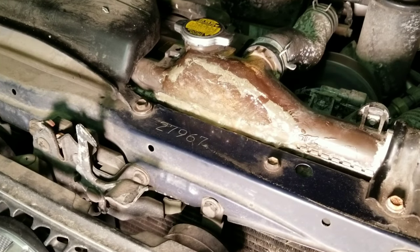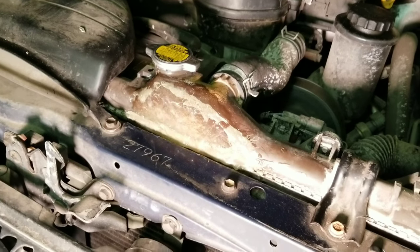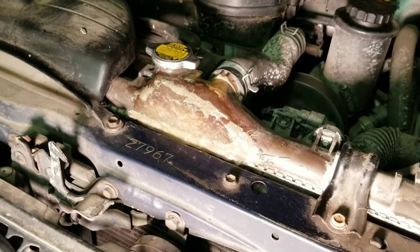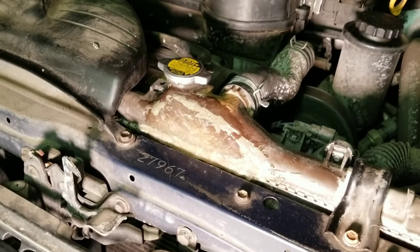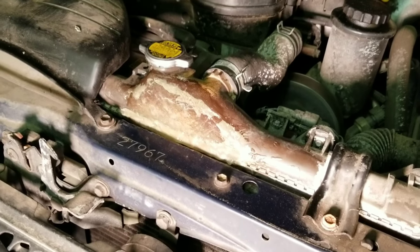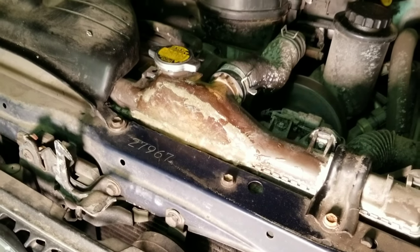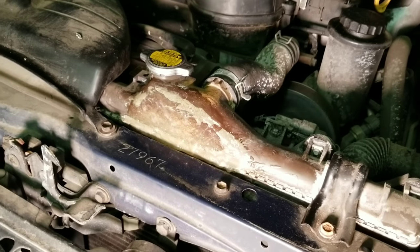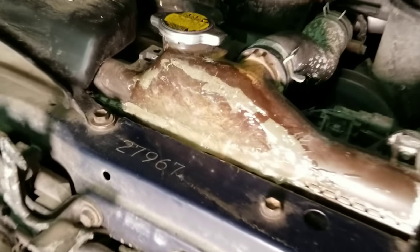So here's the deal: one whole thing of JB Weld — it comes in a cylinder syringe type, you mix it together, use the stick provided, and I'll put what I used in the description. It took me maybe 15 minutes. I cleaned the surface, put it on, and I did three coats. You can't do it all at once because it goops to the bottom. Takes about five minutes to cure. I let it rest overnight, but it says on the box an hour to harden completely. So I put a coat on, let it sit, roughed that coat up a little bit, put another coat on, let it sit, and did the same thing one more time.